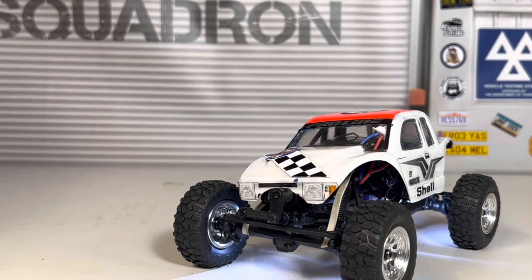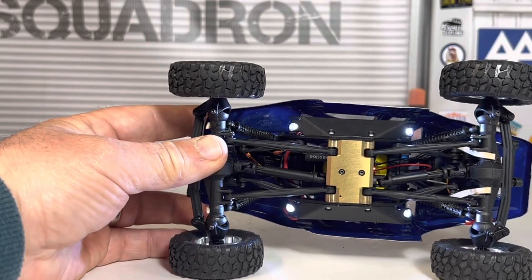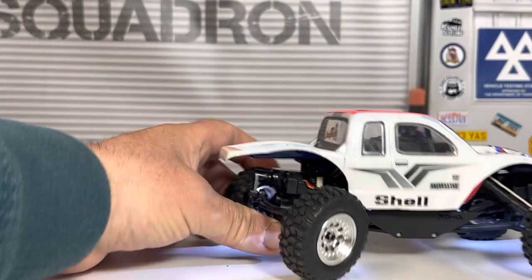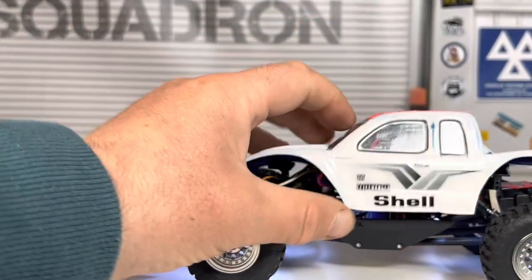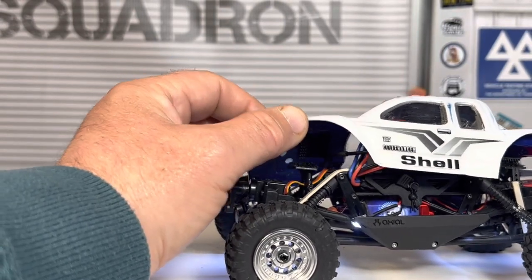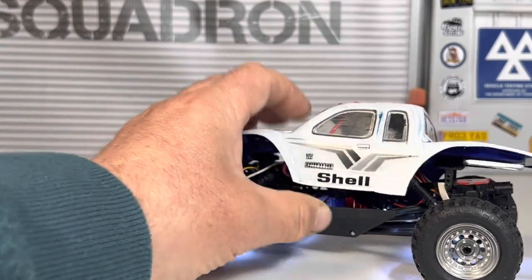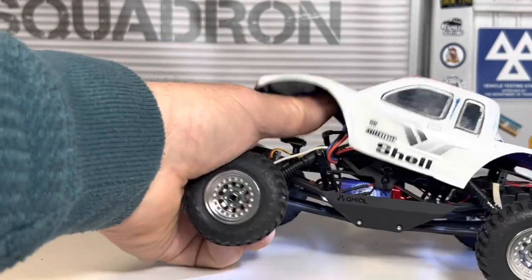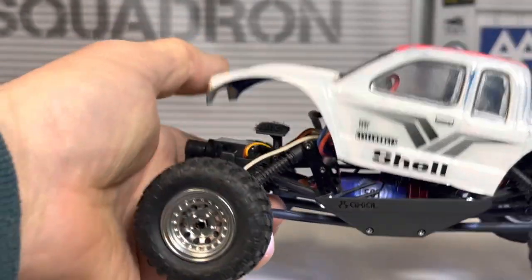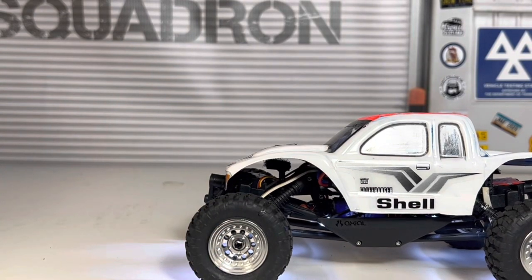First off, I've fitted a brass base plate to add load and weight to the truck. The second thing — actually it's on this side, you can see it better — is a 50-turn motor which I bought on a well-known auction site. It came with a new metal gearbox, which you can see there close to the camera in metallic red. It's added a lot more torque to the vehicle and it's also a little bit smoother, which I'll demonstrate.